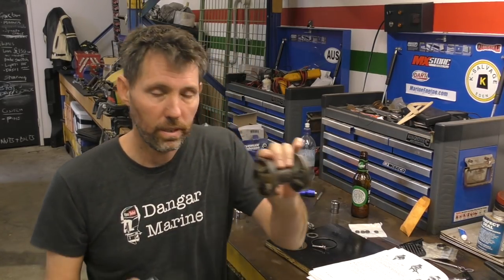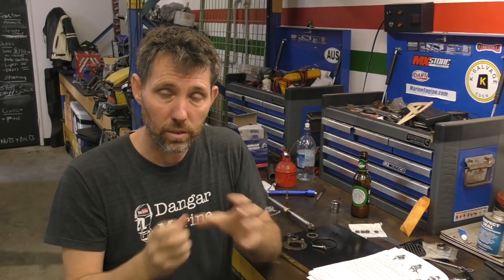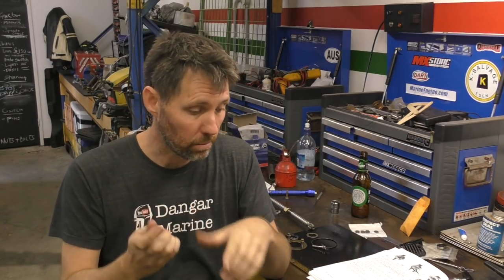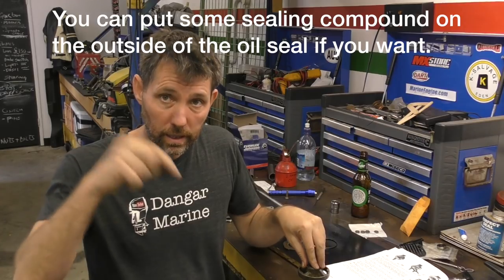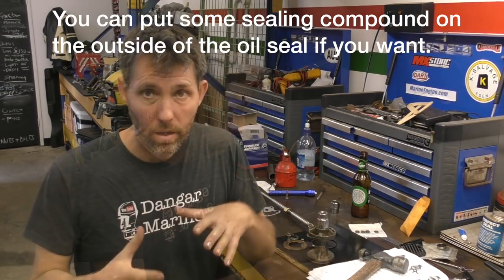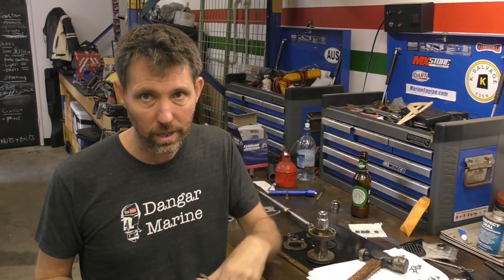This socket isn't a tight fit inside the bearing carrier but it's as big as I can get it, so I can get to the outside edge of the seal rather than crushing that inside lip, so I think this will work well. The first one we're putting in spring side down, which will be going in towards the gearbox to seal the gearbox oil from coming out. I'm going to hammer this in rather than using the press, and as always when using a hammer it's good to have some sort of safety glasses on because things can go flying.